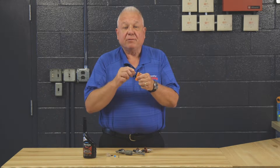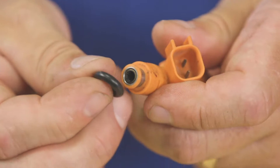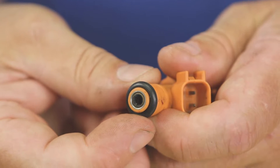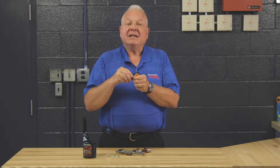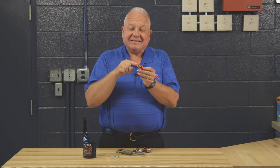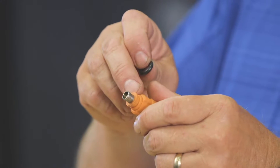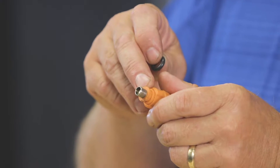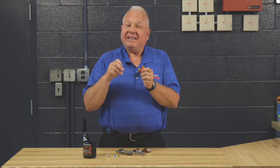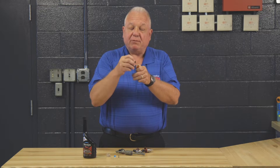What you need to understand is that the fuel injector is sealed to the fuel rail — which is the fuel supply — and to the intake manifold with a rubber O-ring. The same O-ring goes on both sides and fits in this groove. Over time and through thermal cycles, these O-rings will start to get hard and they will leak. It usually does not leak at the fuel side because that's a bit further from the engine, but it will usually start to leak at the engine side. And it's not going to leak fuel — it's going to create an air leak, a lean condition on one cylinder. That could drive you crazy because you could have one cylinder that's sucking air and it's only because of an O-ring.